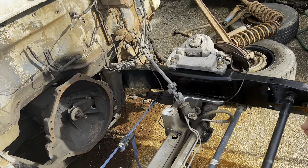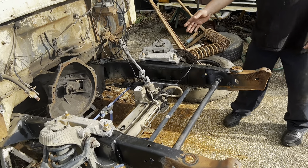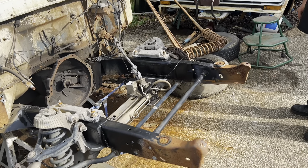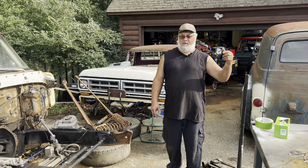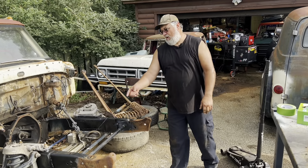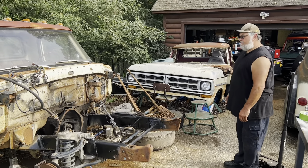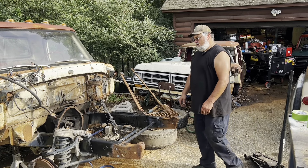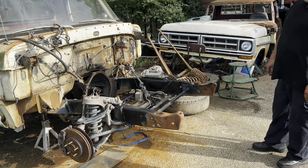He comes in and boxes the frame with the original Crown Vic pieces, and it fills it up too — I really like how it fills it up. I really like how you put in a pipe there to support the front of the frame. I usually leave them — the maroon one does have the bar in it still, but I took it out of the super cab because it was really strong to begin with. I've heard guys complain about the sway bar giving steering input back on Crown Vic swap trucks because the frame's so thin.